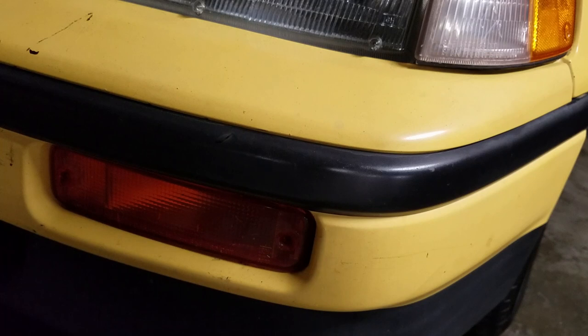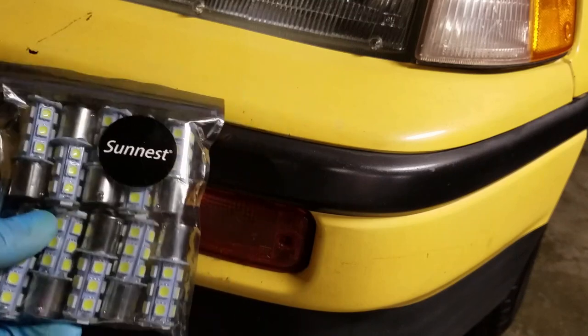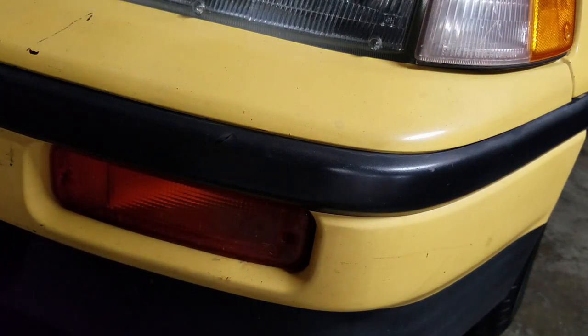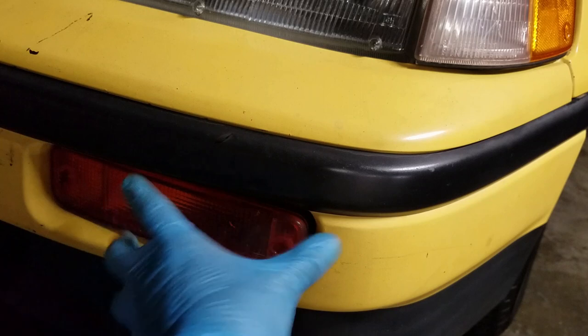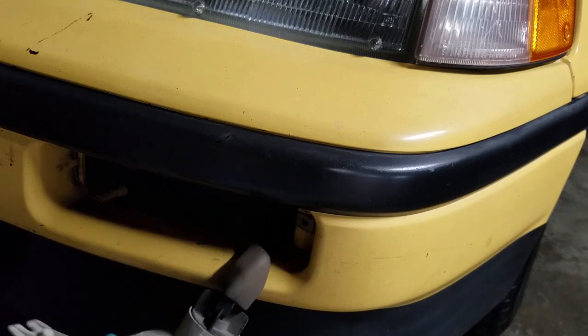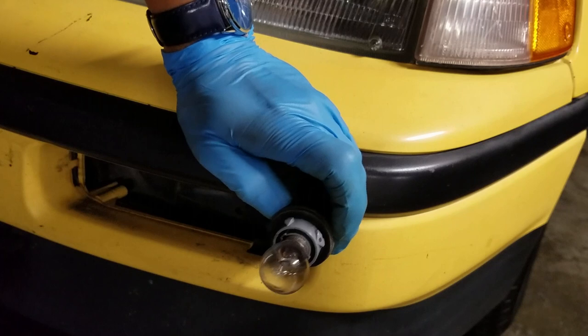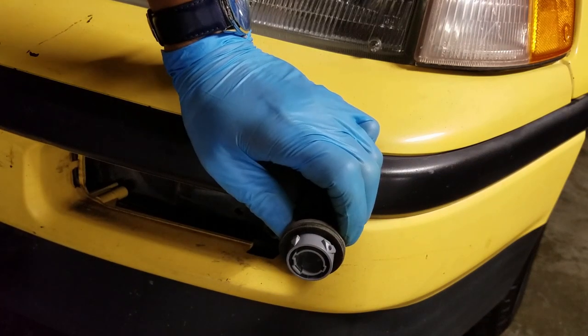This one requires a model 1156 bulb, and I bought that also on Amazon - I'll link to it in the description. It's a 10-pack meant to replace the 1156 bulbs. These require a Phillips screwdriver, and one screw is actually longer than the other. As you unscrew, this housing easily pops out. When I take this thing out - there's my 1156 bulb. I press it in and push it out. The bulb still works, I just want to replace these with LEDs.